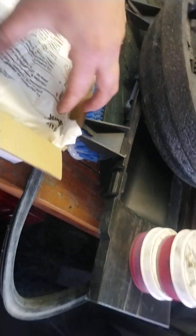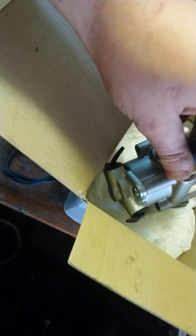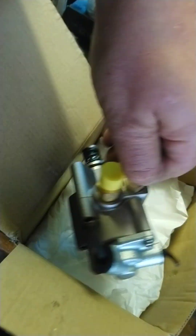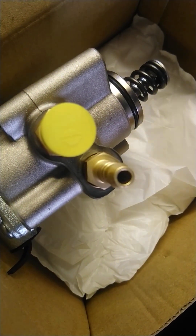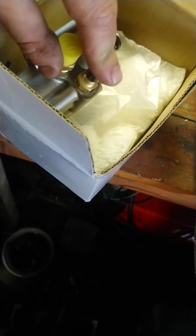I've got a new Bartech pump with upgraded internals. Bartech also saves you the hassle — they drill out the inlet for the fuel inlet: the low-pressure side inlet is normally 1.72mm and they've drilled it out to around 4 to 4.5mm.